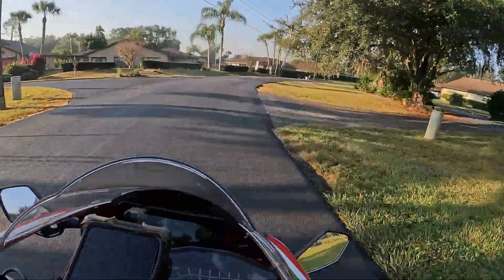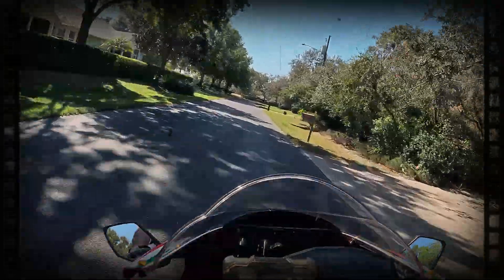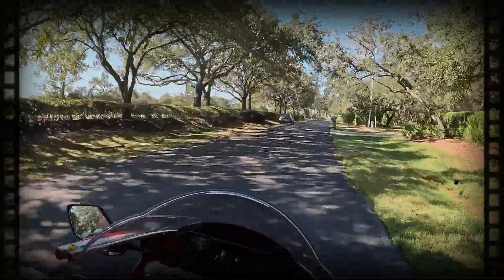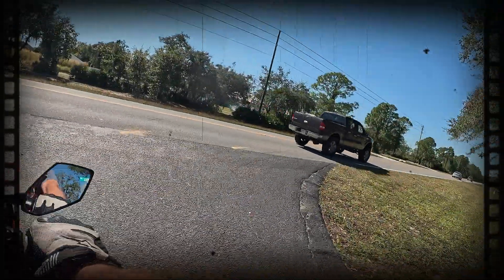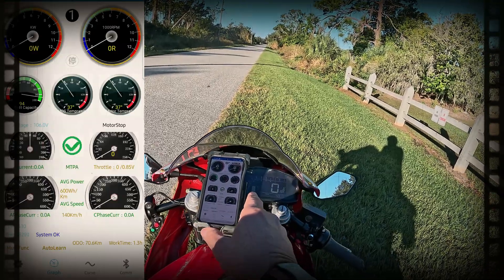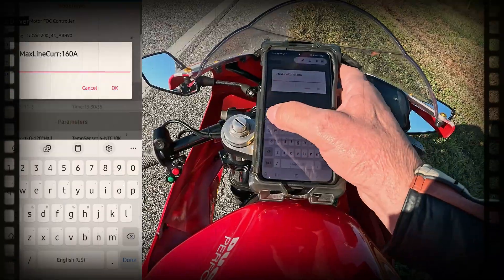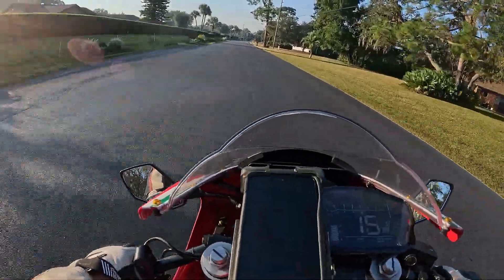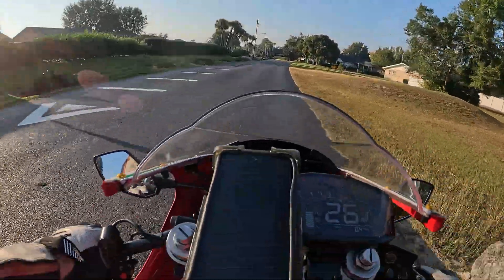So the next video, part two, I got the rated speed but I just got right at the rated speed — 190 amps. Everything below that rated speed is where torque builds RPM, so increasing phase amps gives you more. Everything above that rated speed, we're going to have to use field weakening to increase the RPMs. We know the weak light comes on around 70 miles an hour, 7,000 plus RPM. Max line currents — I went from 120 to 190, and that put me at 8,400. I got the weak light at 8,400. Depending on what the battery volts is, anywhere from 7,400 to about 8,500.